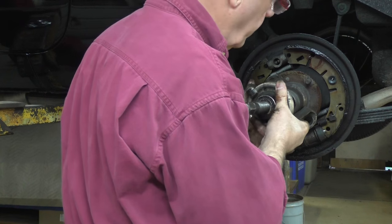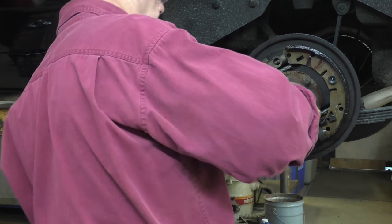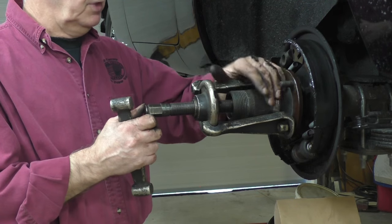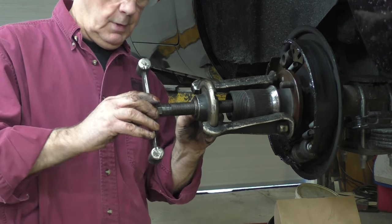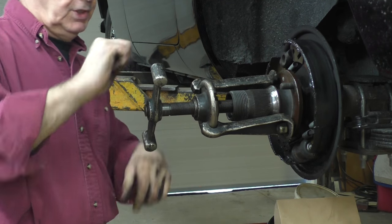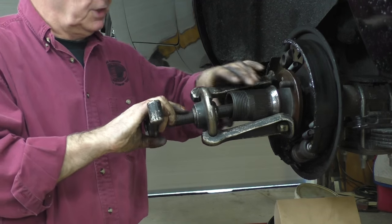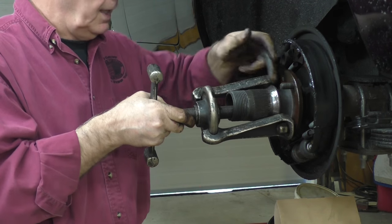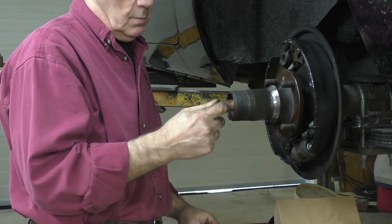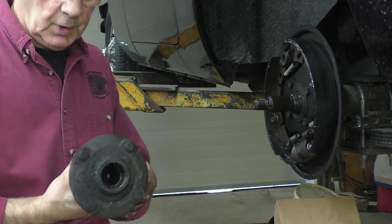So the plan is to put the puller on there, put my nuts on it, get it all centred. Right, I have my puller assembled to the hub. I'll just turn it and if it gets really tight I can bash the end with my hammer. But as it happens it's come off already — I figured this would be fairly loose, mainly because I've got so much oil along the back of the plate. The hub wasn't exactly tight. And there — we've got the complete piece off.